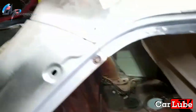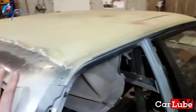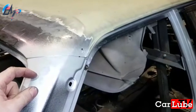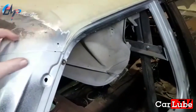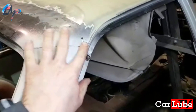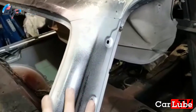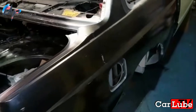All the panels are on for the last time. I've fully unpicked all the original braze joints. Not many people know this, but the roof skin on the C pillars and A pillars actually has a step down in it - that was pressed in from factory. The roof skin steps down underneath the C pillar and the A pillar on the car, then the rear quarter basically meets up to it. You bolt it down, clamp it down, and it's a braze joint - you heat the panel up and braze weld into it, allow the braze to run underneath the panel filling the gap, then file it down nice and smooth. It gives this panel rigidity so there's no flex and movement between the two panels - it makes the body stronger. It's like a fully welded joint, but a braze joint can be unpicked to replace the rear quarter at any time.